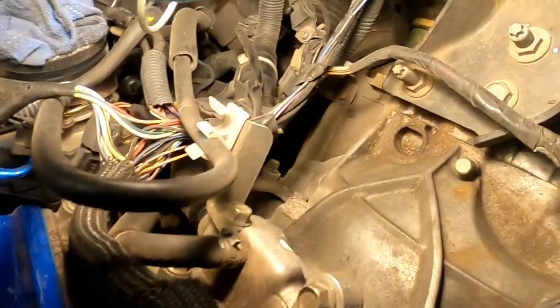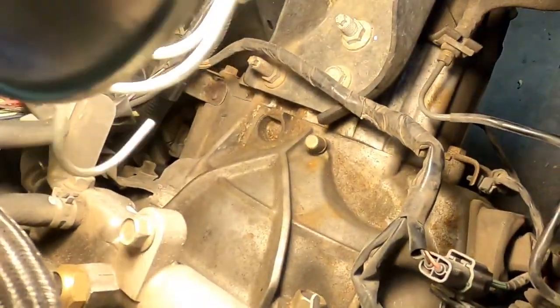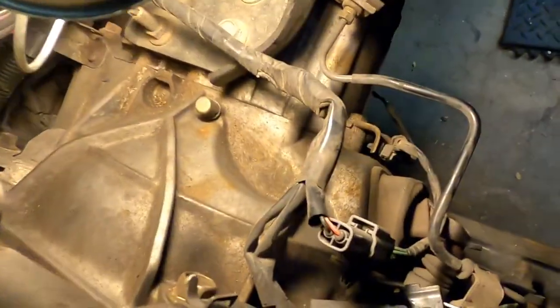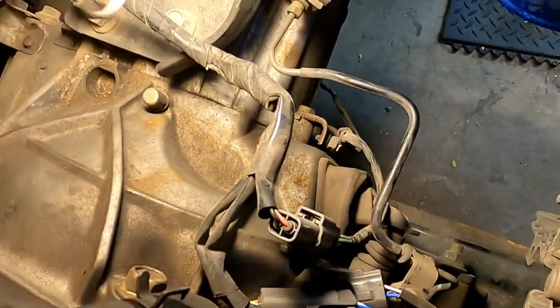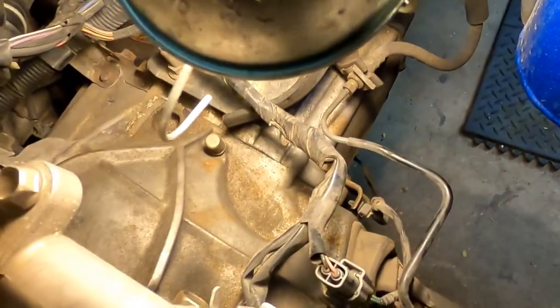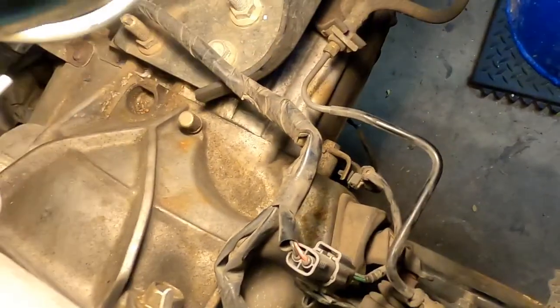One, possibly two back there, but two, it is in fact two, 10 millimeters back there. Unplug these three wires here. If we remove that clip right there, we can actually pull that brake line straight up off the trans. Might take this one out here, leave some tension, relieve some tension, not alleviate, we're not painkillers.